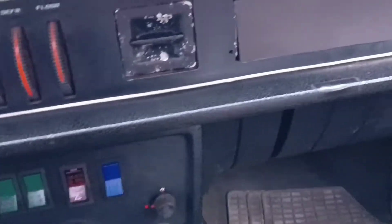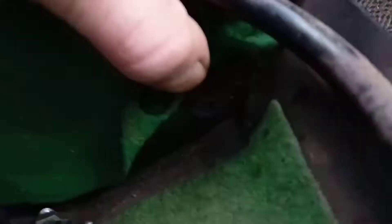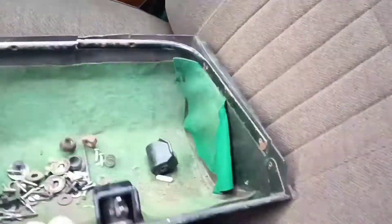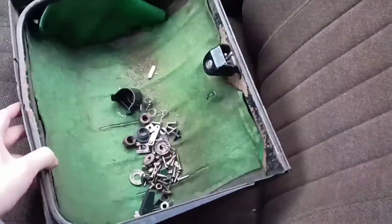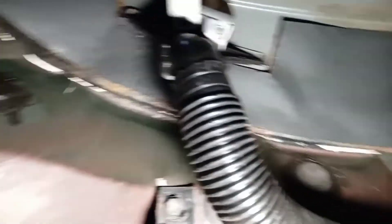For us auto enthusiasts, it's no secret that the heater is hidden under the dashboard. My messy glovebox must be detached to get access to the heater. It is fitted with two bolts, and these bushings are very important — without these bushings the glovebox very often opens on bad roads and the frame of the glovebox can break.